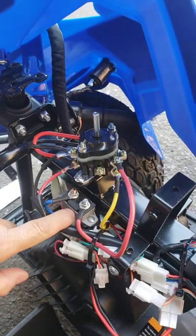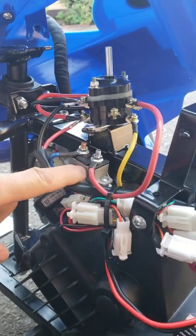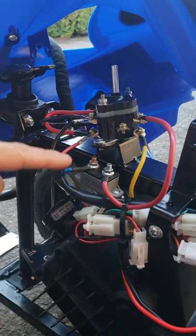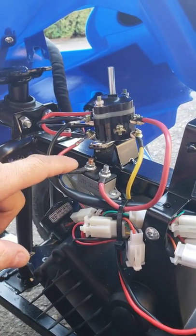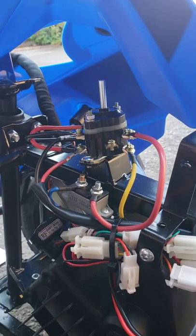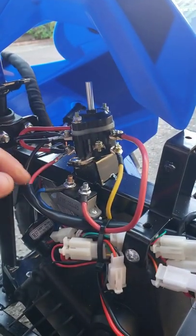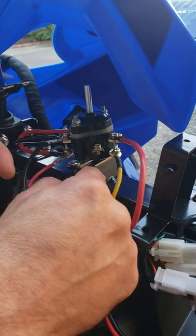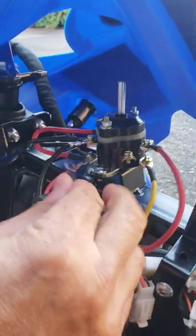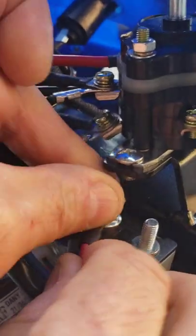Your overheating relay might look okay from the outside, but that does not mean it's not faulty. If this overheating relay is faulty, it will not pass power through — it's basically connecting those two wires together. The easiest way to test if this is the problem — why your ATV is clicking but not moving — is to remove this nut right here and attach this wire to this blue one, so together.